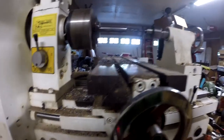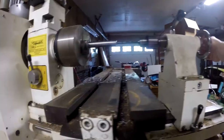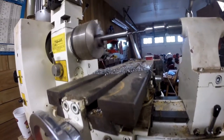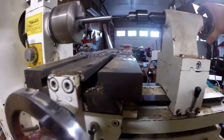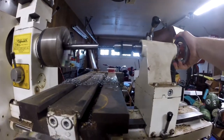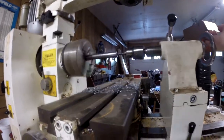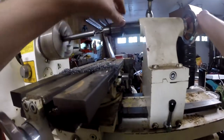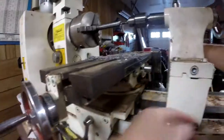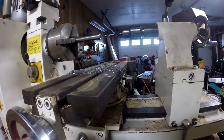Very well so far. The little curlies are coming out perfect. This does make it a little bit easier to drill through since it's already been drilled through the center. This must be as far as I drilled with the smaller bit — it's getting a little bit more difficult. We're about at the right depth. Drilled up to here, which is way more than enough. When we tap that, that'll be plenty of room for all the shavings to go down at the bottom and have more than enough threads. So that's perfect.